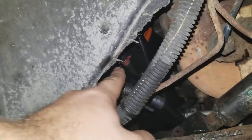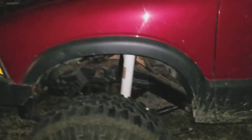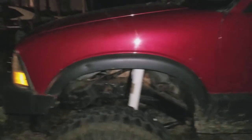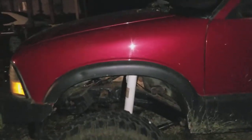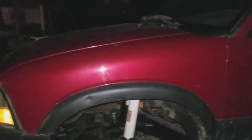You can see I've got it plugged off right there - it's built and set up for hydro boost, and that's the next mod to do. With hydro boost, I'm going to use an Astrovan hydro boost - factory part, bolts in, and if it breaks I can go to the parts store and get one. Hydro boost just brakes better, and I bought a 4BT, so once it's a diesel you need hydro boost since there's no vacuum.